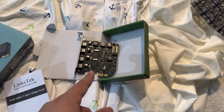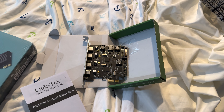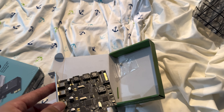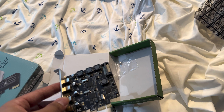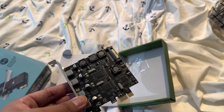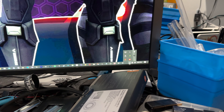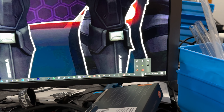So I'm an idiot — this card only does five gigabit per second and is USB 3.1. It's kind of breaking on me because if I don't plug in the external drive, it runs, but then there's no internet, because my other PCIe card is a 1x1 and for some reason that's somehow linked to it. I have internet now. I need to learn lanes for PCs — the general gist is that the motherboard and CPU control all the PCIe lanes. Half the lanes belong to the CPU, half to the motherboard, and you only have a limited number of them. You can plug in as much as you can, but there's only a certain bandwidth. So I need to find another USB 3.2 card that doesn't mess with all that.